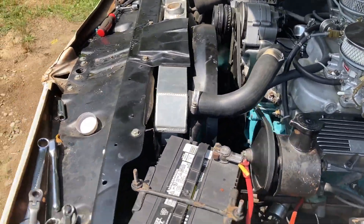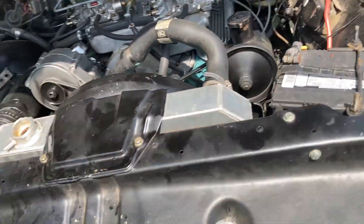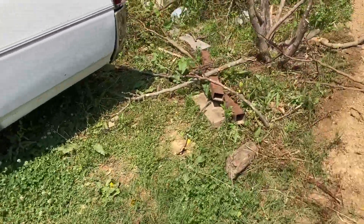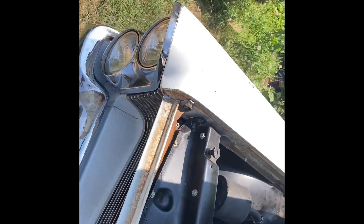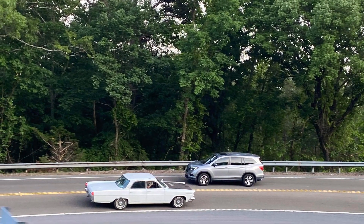I'm filling up my radiator with antifreeze. I like to use a paint filter to catch all that garbage and keep it out of my cooling system. Got it running now and it's not knocking — it's actually pretty quiet. I'll let it warm up for a bit to seat the seals. It doesn't appear to be leaking or seeping anywhere, but I'm going to drive it and watch it get real hot just to be sure. New water pump was a success — I appreciate y'all watching and don't forget to like and subscribe.